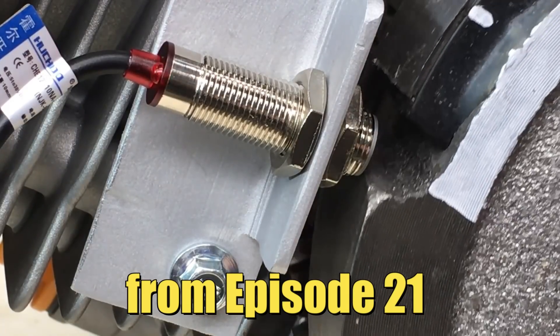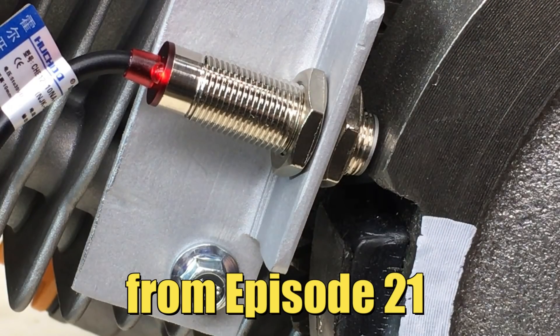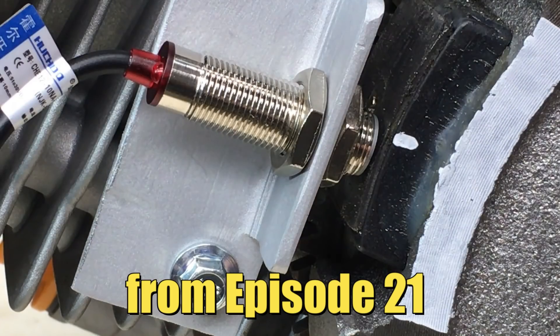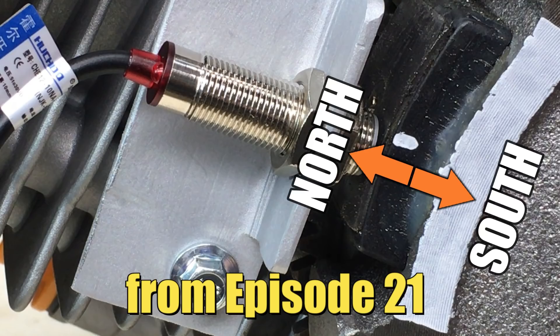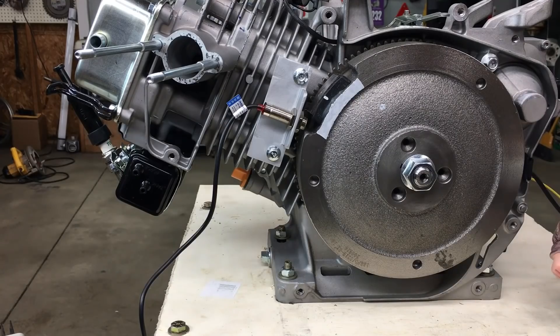Okay, it turns on here, but not here. And it looks like it turns on here as well. This turns out to be a huge problem, and there's no easy solution. You see, these Hall Effect proximity sensors can only detect the south pole on a magnet, and the magnet attached to this flywheel has the north side facing out. As it stands right now, we're getting two triggers, one right next to the other, and that will not work with this ECU. It'll actually confuse the ECU and the engine absolutely will not run.